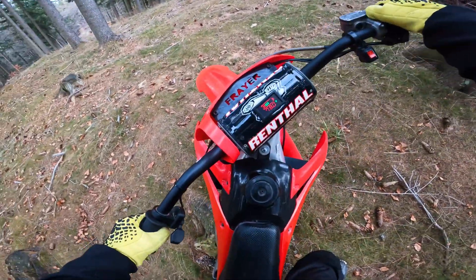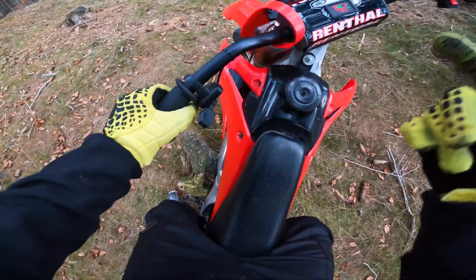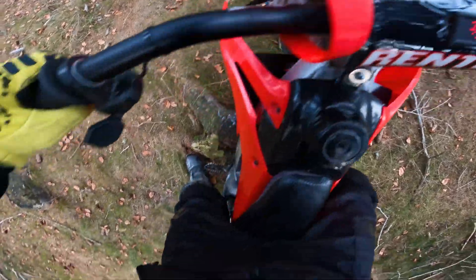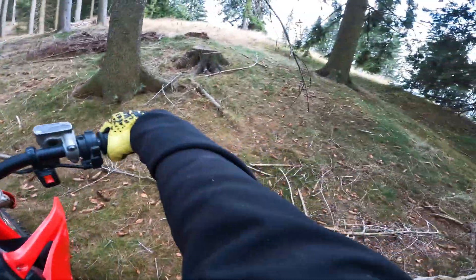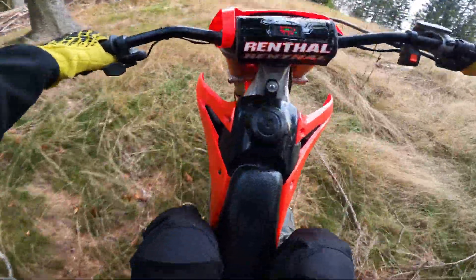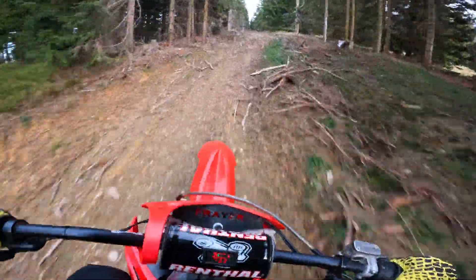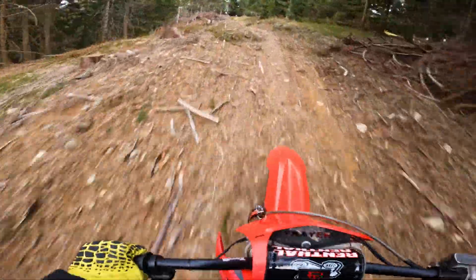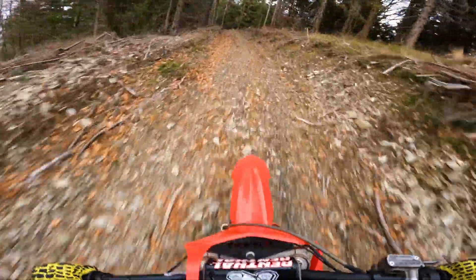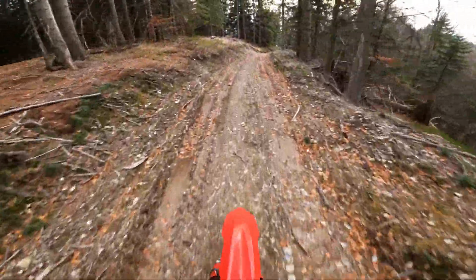He's at 78 volts, 69%. We're gonna go downhill and try to use as much regenerative braking as we can — that's when you brake only with the motor. The motor creates friction that recharges the battery packs. We're gonna see how much juice we can get from riding downhill. 70 volts.